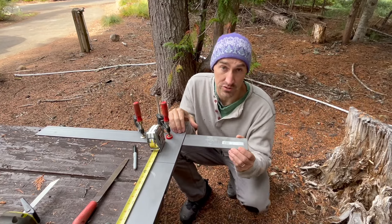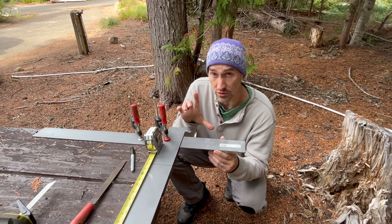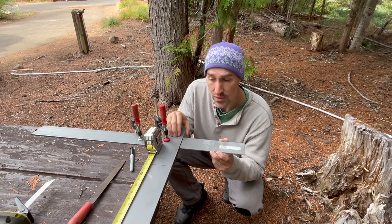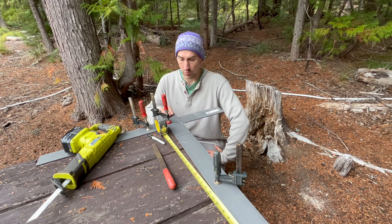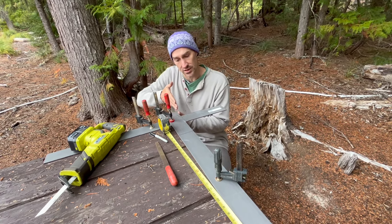When I started to mount the trailer steps last week, I decided I didn't want to drill additional holes up in the trailer frame because it might further weaken it. So I'm going to use these adapter plates to maintain the structure. I'm cutting this one to 26 inches and using this one as a guide to make a nice straight cut.